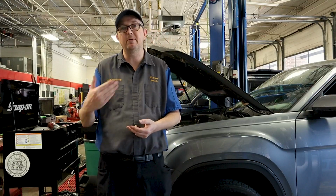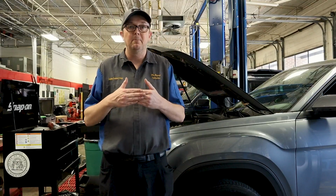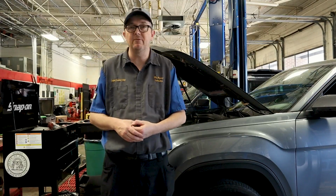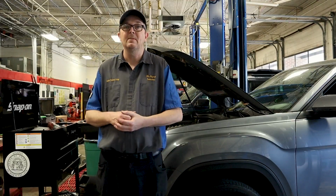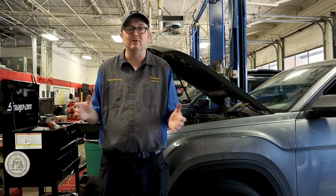The brake pedal is going to feel weak for the first couple of pumps. That is just going to reset the caliper pistons and get everything lined back up. After that, you need to check the brake fluid, check the level, and check the condition. If you're unaware of how to check the condition, I will put a video in the description that shows you how to do that with a multimeter.